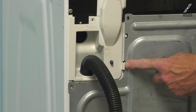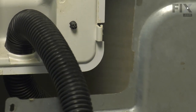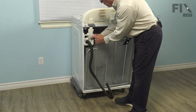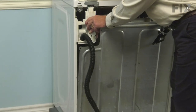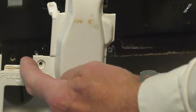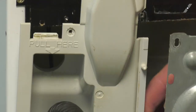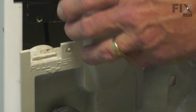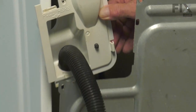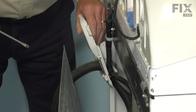You may need to depress the little plastic clip on the existing drain cover. With it tilted back, you can then grasp that connector and just pull down on it slightly, and disengage the two tabs on the top and the one wide one on the side. Now on the back side of that connector, we'll have a wire harness attached — you'll need to remove that. Simply take a flat blade screwdriver and pry it out, or push the connector through from the back side with a pair of needle nose pliers.